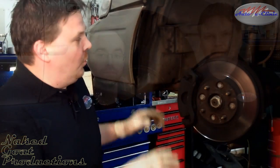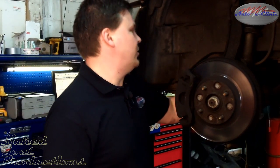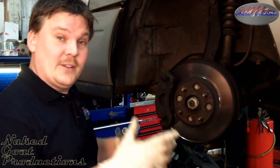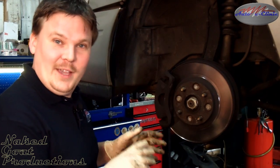Hello and thank you for tuning in to AutoEclinic. My name is Aaron and this is Michael. Today we have a 1995 Honda Accord EX with an unwanted excessive amount of movement and vibration in the front suspension. We're going to replace the left front axle. The axle boot is broken, which allows a lot of dust and debris to get in and the grease to come out, so the axle is worn out.